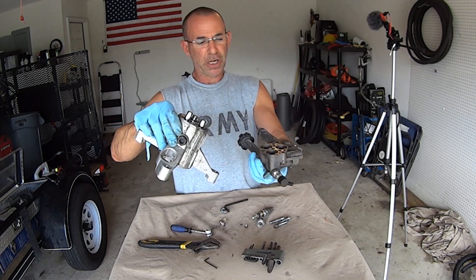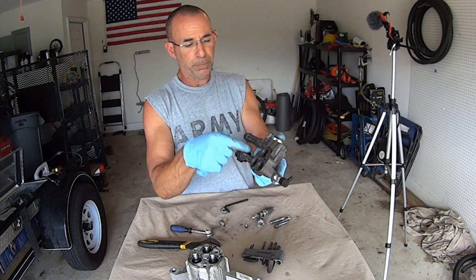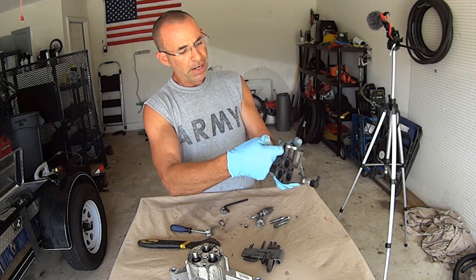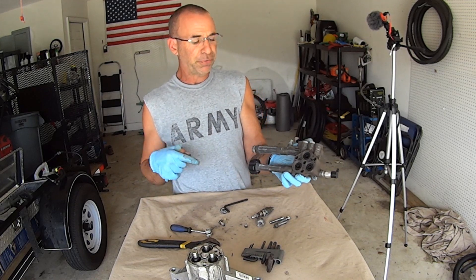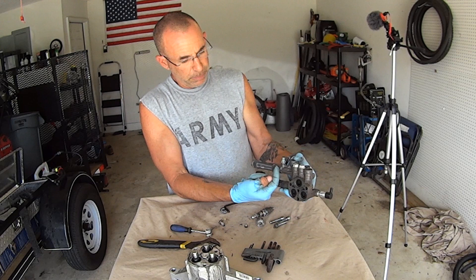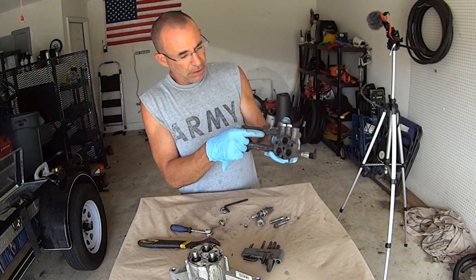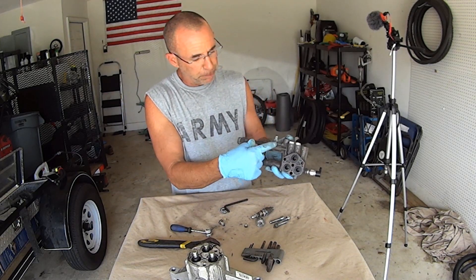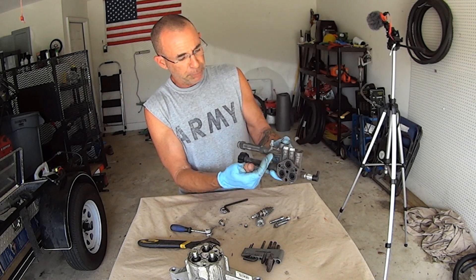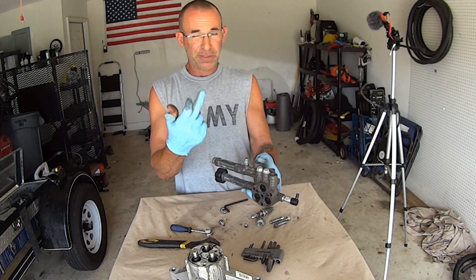So there you go — that's how it works, there's your pump and your housing. How a pressure washer pump works: three pistons, pull and push, pulling water and pushing water. As it pushes, it pushes against these check valves, comes around, and goes out your wand. As it's going out your wand with a good flow, it siphons in your detergent. If you don't have a good flow, pressure starts backing up and the little ball with the spring gets pushed up because water isn't flowing fast enough to pull the ball down against the spring.